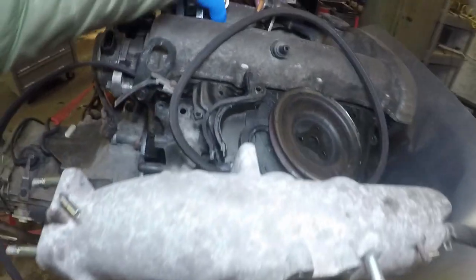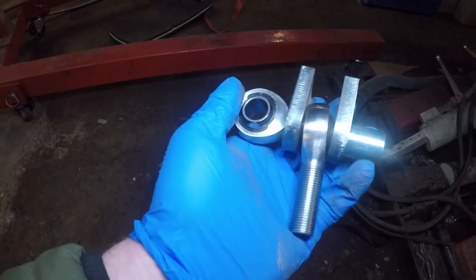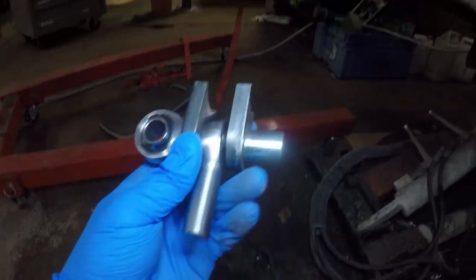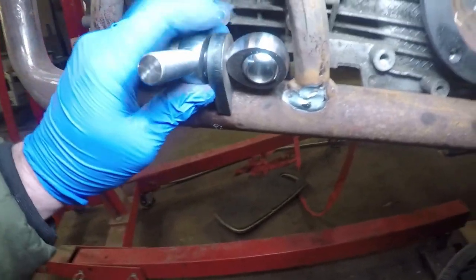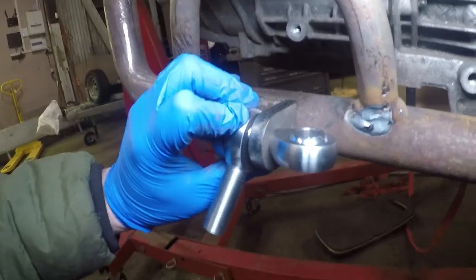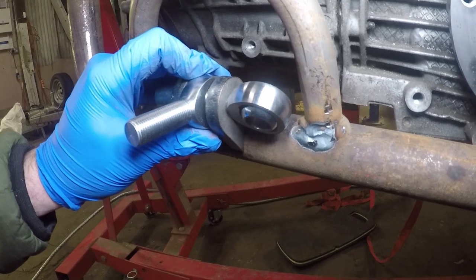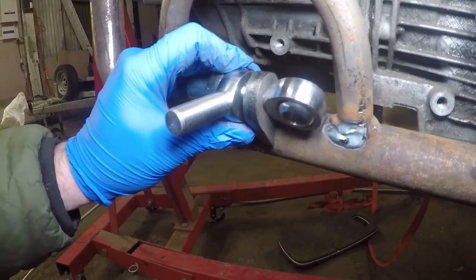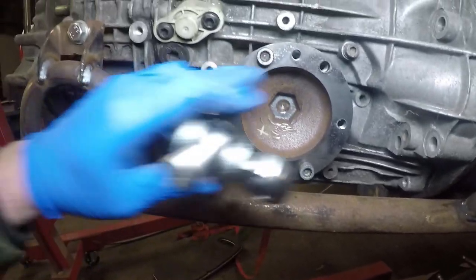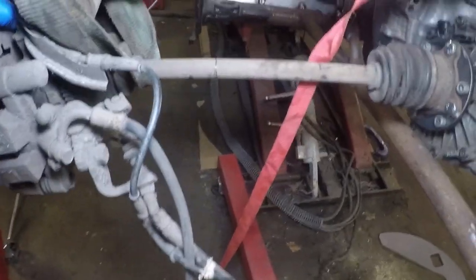I've also not got any M16 bolts so I'm having to use a rose joint as the assembly bolt. My original plan was to have these angled up slightly — like that — so you've got a chance of clearing things on the ground if you've got your chassis on the floor. Mounting them up at an angle would give a little extra clearance and get the arm a bit higher, which would bring it closer to the center of the driveline. Because these driveshafts are designed to go in and out for when the arm travels up and down.